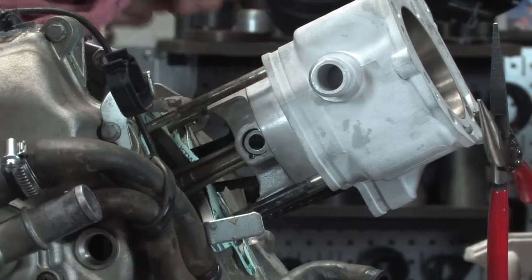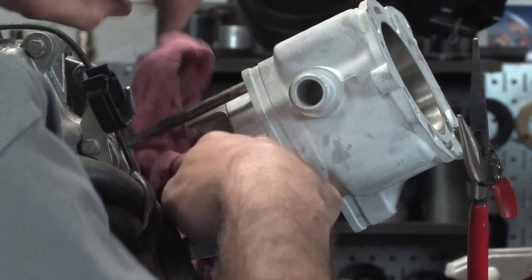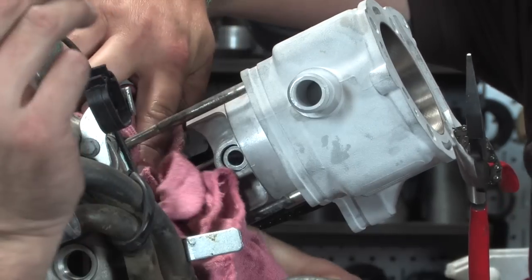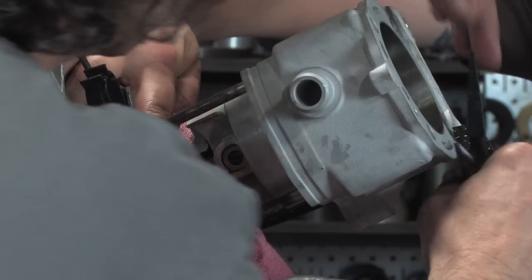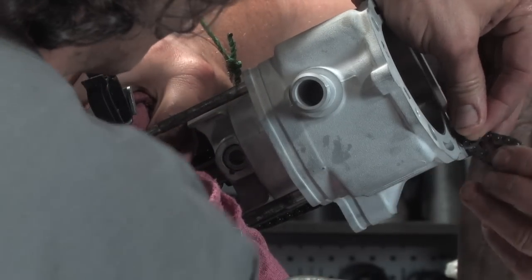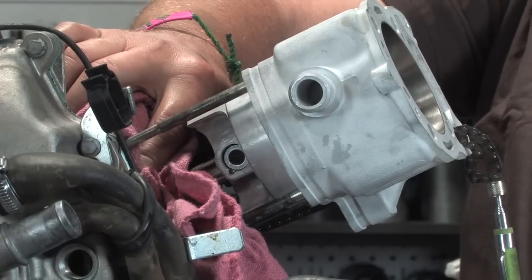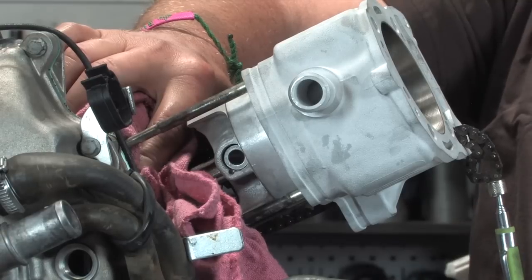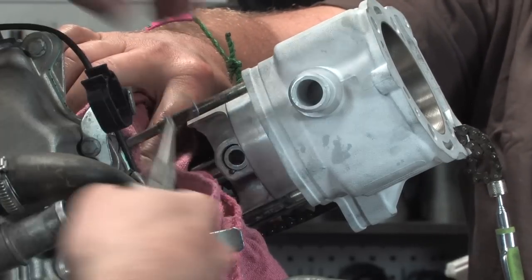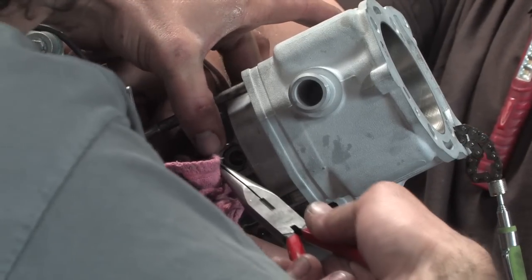And you'll expose the little clip. Good idea to just shove a rag in there temporarily. Don't want to lose this little clip in that hole. Just for a second, Steve's gonna hold, if I had two needle nose, or you could use a magnet just like that, check that out. See, it just keeps the chain from falling. Again, just like I showed in the other spot, grab the clip, from the very edge and just work it in there.